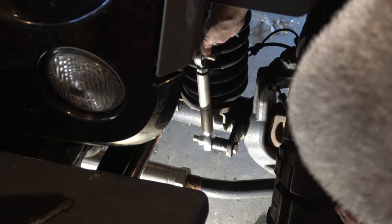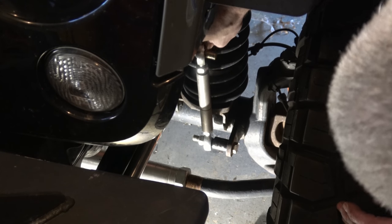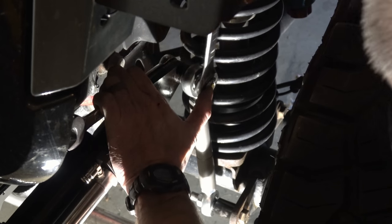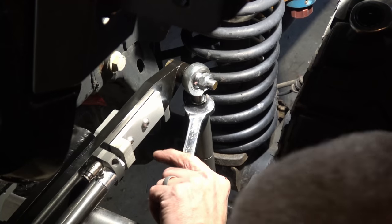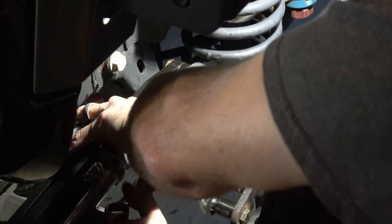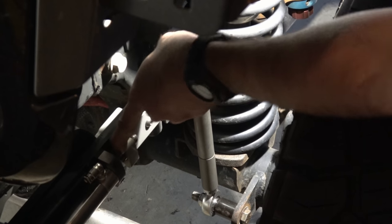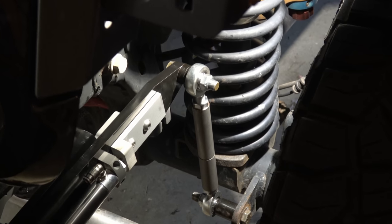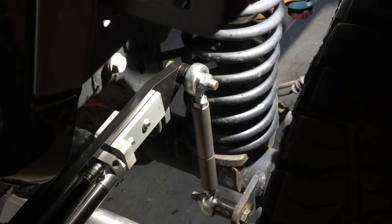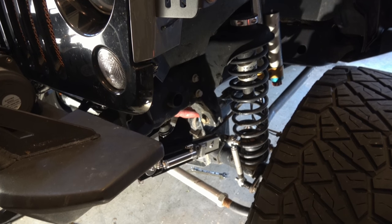On the driving torsion bar — the on-road larger outer diameter one — you can actually tweak it to the point where it might actually introduce some pull into the Jeep. So what you want is to get that last link set up so that everything latches easily. Once I get it all tightened up and adjusted, you should be able to freely move that latch mechanism in and out. I can manually open it up and then it closes right up. So if you have to force that or rock the Jeep significantly to get it to go into place, then you probably don't have your links well aligned.